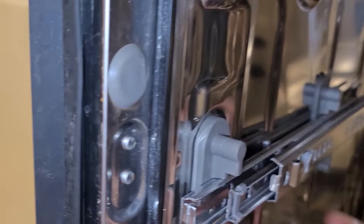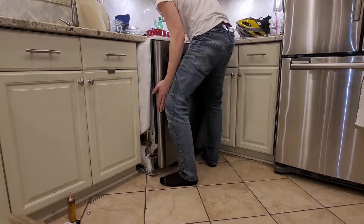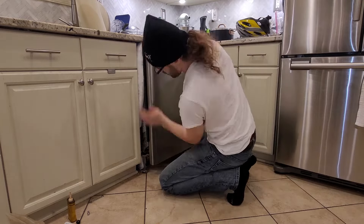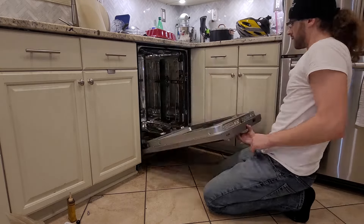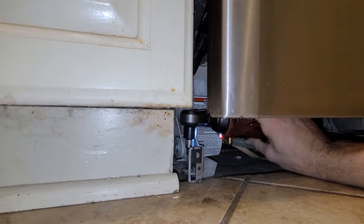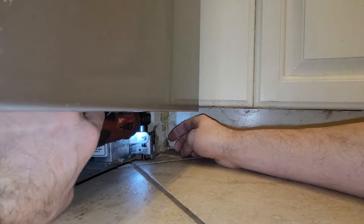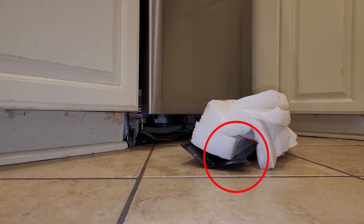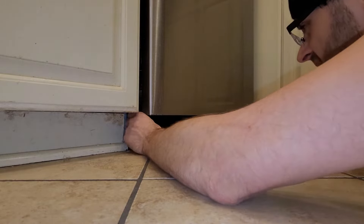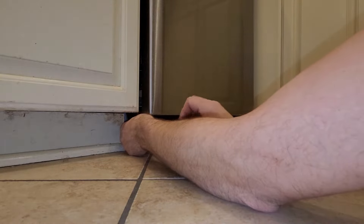More or less good as new, and we're pretty much home free at this point. Gently push your dishwasher back in, making sure that the insulation material doesn't get crumpled or folded. Once it is in place, make sure you test the door — make sure that it's not hitting any handles or drawers. Raise the feet again to their original position, and it's probably a good idea to check the door one last time for interference. Put the bottom plate back on with the tabs facing upwards, and put those same two Phillips screws back in.